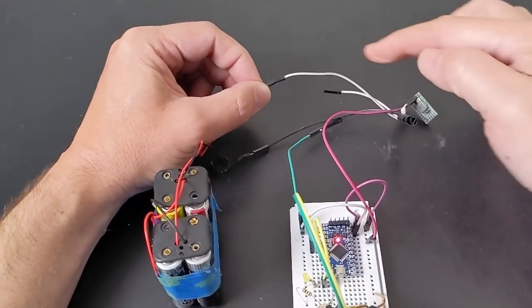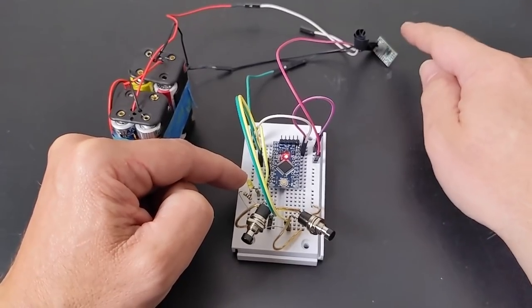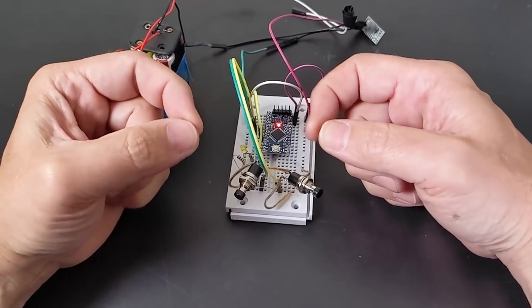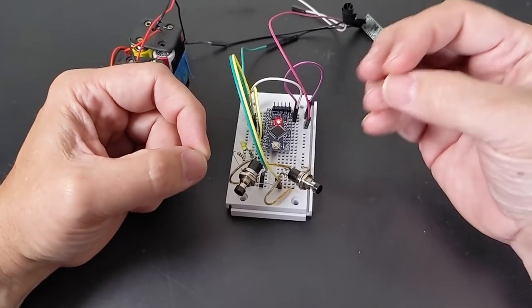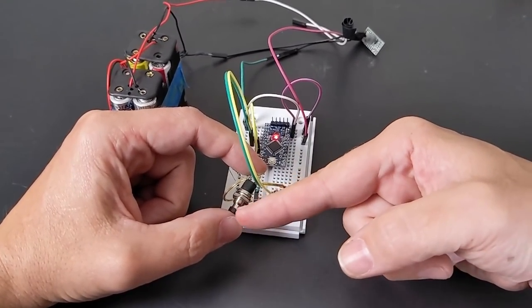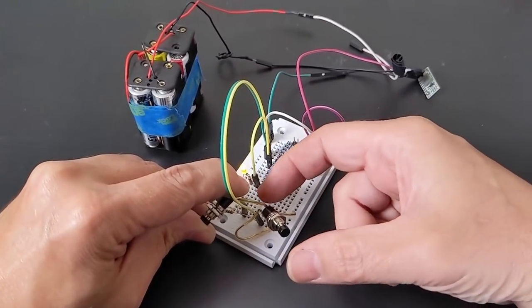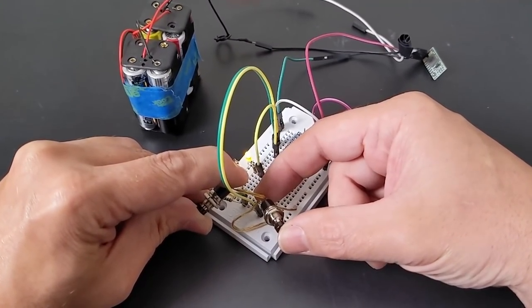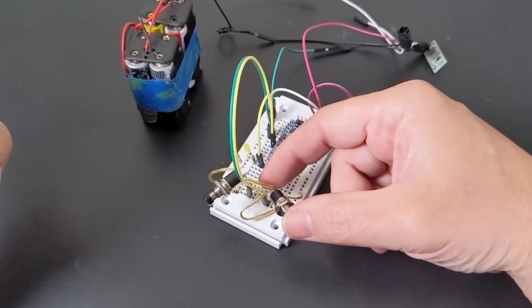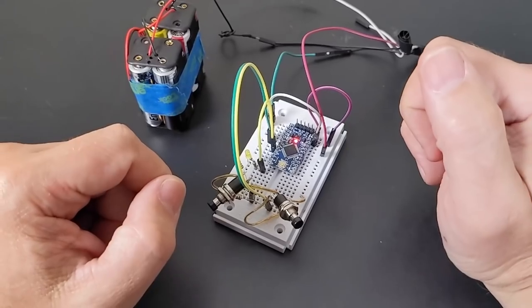Here's the mock-up: a 12-volt battery pack feeds power through the buck converter into the Arduino running on 5-volt logic. Two push buttons emulate the 12-volt pulses that would come from the motorhome wiring. One button is for the running lights — pressing it turns the yellow light on. The other simulates the turn signal — pressing it activates blinking. Both functions work independently as well.